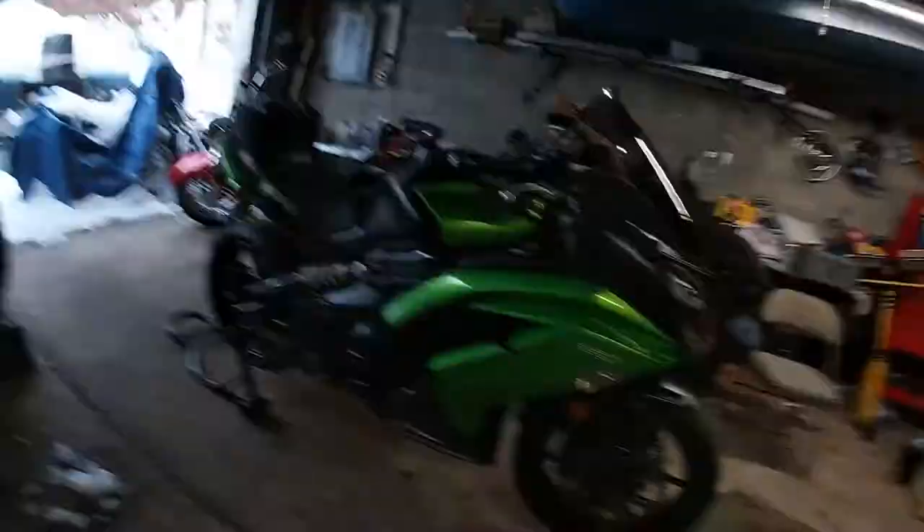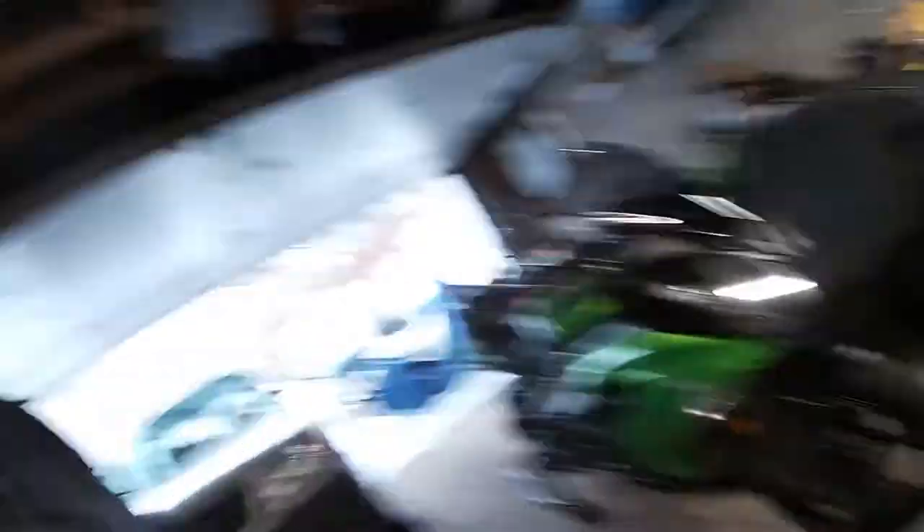Since it's super cold out and I've only brought my hoodie, if you've got a heater go ahead and crank it up because it's chilly. Because it's chilly, we're actually going to be going with 5W30 oil, not the typical 10W30 that I run during the summer in the warmer months.